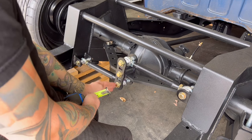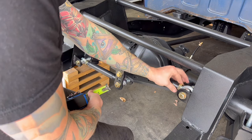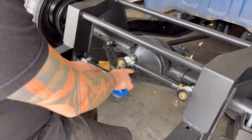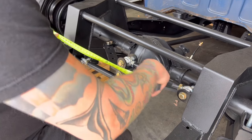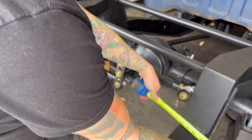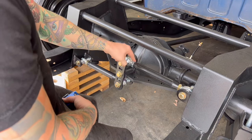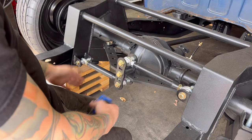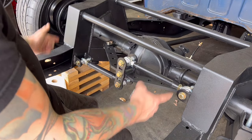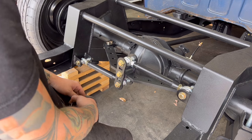Now I want to make sure the bars are straight up and down, then screw those where they need to go since we're centered. Another way to check: measure from the inside lip of your wheel to the frame — we're right at 9 inches. Do the other side — right at 9 inches. I'll go ahead and get a wrench, tighten these down, and we've got a watts link. I'll test it — air up and down, make sure everything looks good, air all the way up and check center, then all the way down and check center.